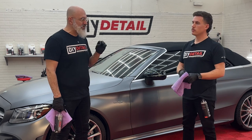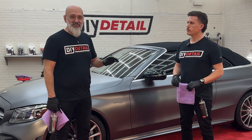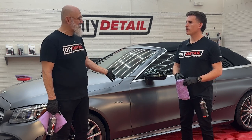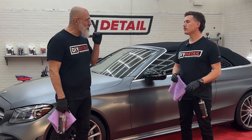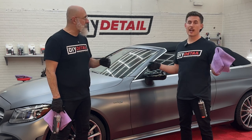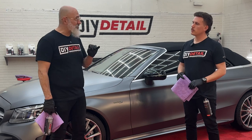We just have to be a little bit faster in our leveling. One misconception in the industry: matte paint is different than regular paint. Actually, it's exactly the same. It is the same clear coat that you have on your shiny car, but they add one little thing — a matting agent — and that gives you this look. But 30 seconds with a polisher, this is shiny. It is the same paint, the same clear coat you're dealing with on a shiny car; it just has one infinitely thin layer of matte on the surface. So if you have a matte paint car, the only time you're going to bring the polisher out is to polish the windows or glass. You never, ever want to touch a polish or a polisher to matte paint.